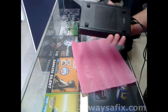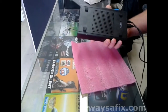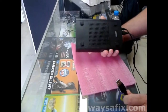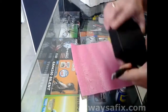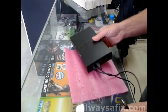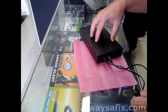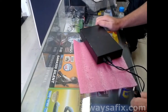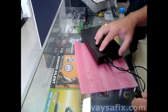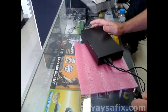Today we've got this external hard disk. When you plug it into your computer, you get a signal that it's an unrecognized device, or the computer does not read from the hard drive at all. There are two possible reasons for this: something's gone wrong with the actual hard disk itself, which is a serious problem, or sometimes there's just something wrong with the actual case.